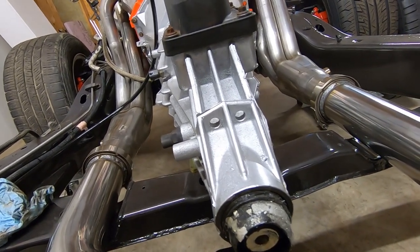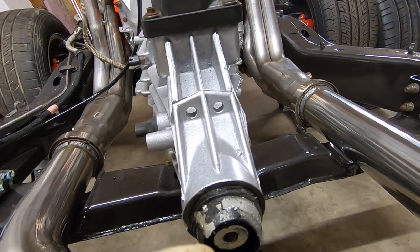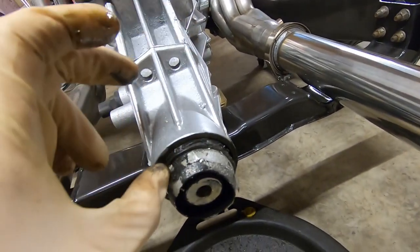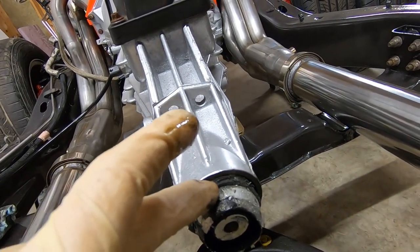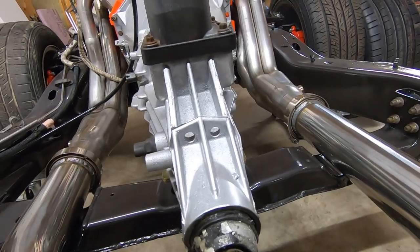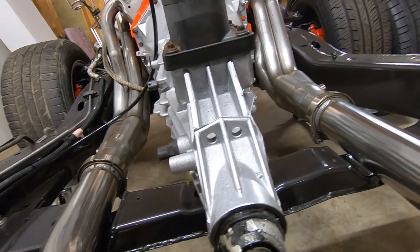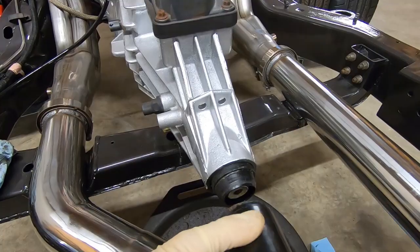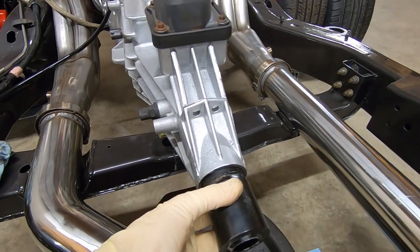It's different diameter tubes pretty much, and you slip it over and you're able to tap on it. You can use a socket, so if you can get a socket that fits over and grabs on this small surface here, really anything that you can get that fits over this boot and drives on that will work. So if you don't have a seal driver, you can use a large socket to fit over that, or a piece of exhaust pipe or anything to fit over that and drive that seal in. Our driver here, we're going to set that on there and just lightly tap that in nice and even all the way around.